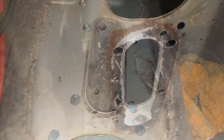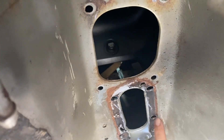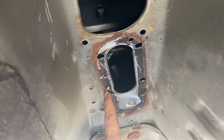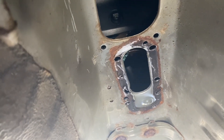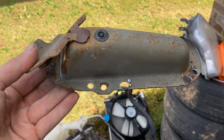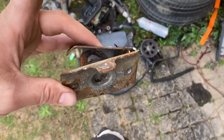When you knock this crap out, do not damage all this metal up here because you don't want to warp it, especially these two back here where your shifter is going. We ended up drilling out multiple more down here — you can't get it off from the top, you have to come from the bottom. That one right there was being a little booger, but we got it. Dust it with spray paint so it won't rust. Got that off all nice and neat — there's all the ones we had to drill out: a total of ten, plus the tips — so about twelve, but it came out good.